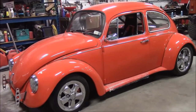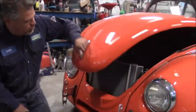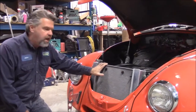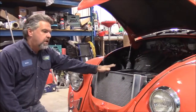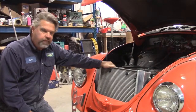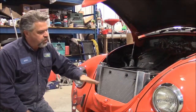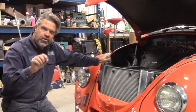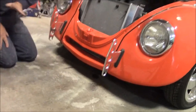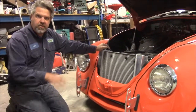As you come along the front of the nose, it doesn't look like it's a huge amount of work, but this was a lot of work. Here's where we had the radiator installed — this is a three-core aluminum rad. It has a rheostat built in that comes on and off with a dial we've preset, so you don't have to worry about turning switches on or off. It has a high capacity S-blade fan for cooling, but we found it still wasn't getting enough airflow. We built a small scoop in the bottom, but we didn't think it was going to be enough. We mentioned to our client we were probably going to have to do a cutout to get more air, but we wanted to try without cutting into the body because he wanted it to look as close to a stock beetle as possible.